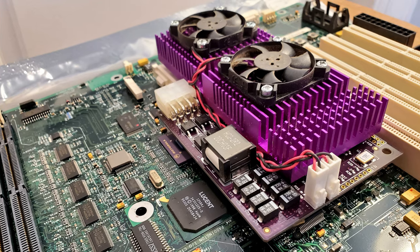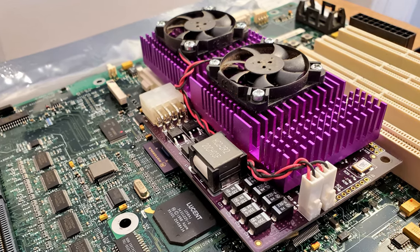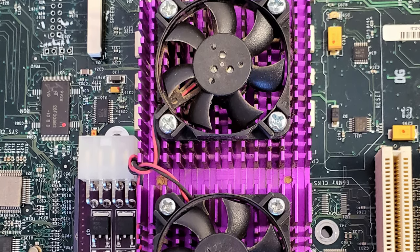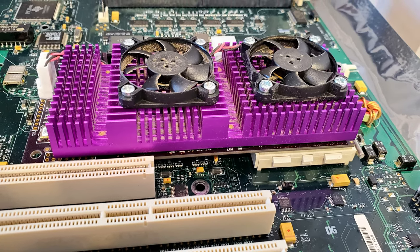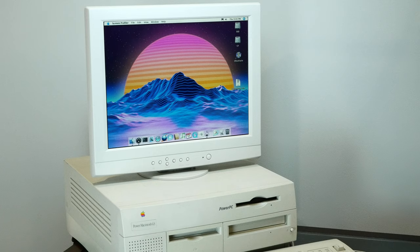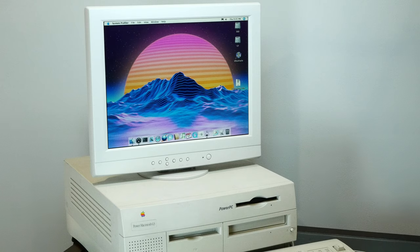Now, this beautiful purple monstrosity is a Sonnet Encore G4 Zif processor upgrade with a 1 GHz PowerPC G4 7455, which is a rather newer version of the G4 that was used in most of the actual Apple G4s. This has 256K of level 2 cache and 1 full megabyte of level 3 cache. It was released in April of 2003, and this beast originally cost $700 and was the top model of several